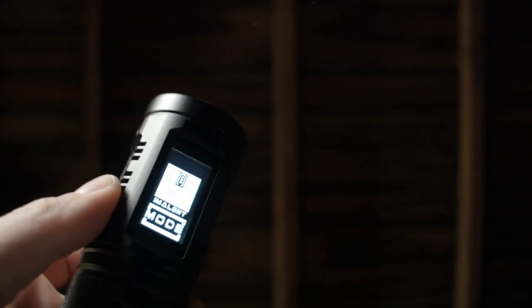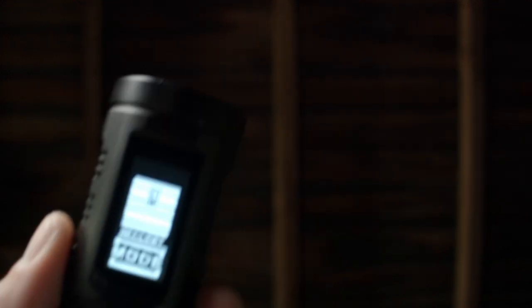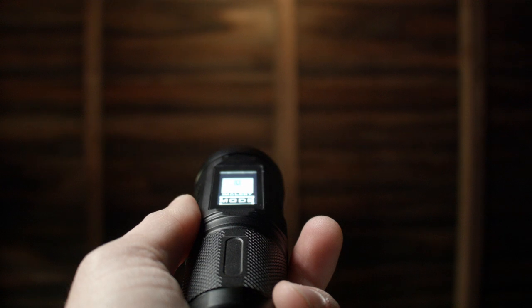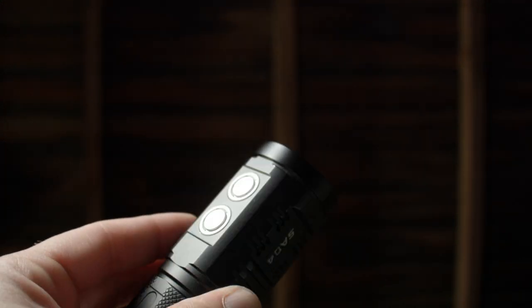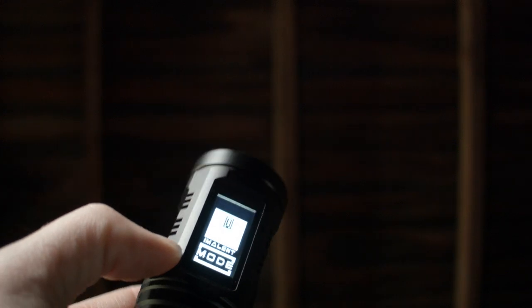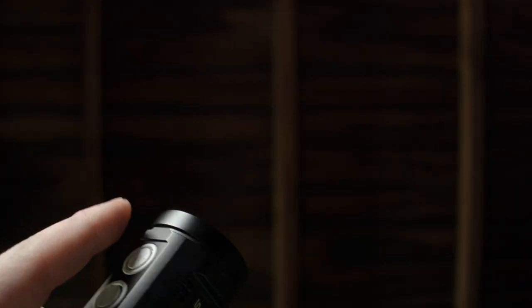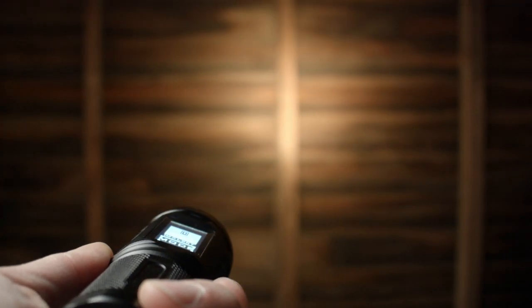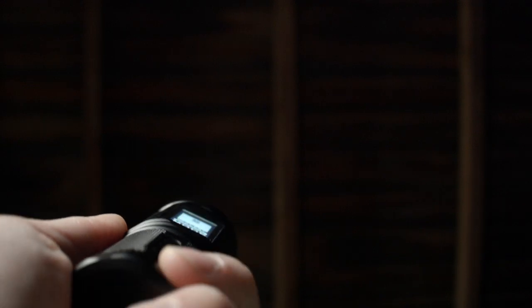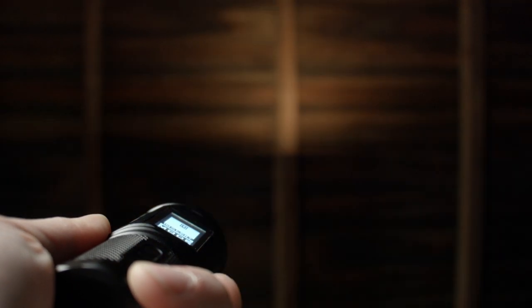Life is just a series of disappointments. For strobe watchers, there are actually three white strobe mode outputs in addition to felony mode red and blue strobe, and the white light modes are completely dimmable. To find them, turn on the light, then hold the mode button underneath for half a second. First you get freak-out strobe, another half-second press gets beacon strobe, a third half press gets SOS, and another half-second press returns you to regular flashlight mode. The strobes are not saved into memory. The white strobe modes are fully dimmable and you can control the color temperature as well.